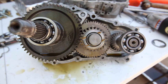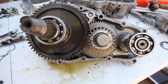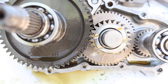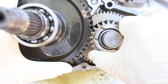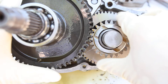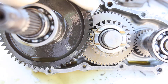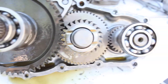I want to focus on what good gear engagement looks like. Let me expose this a bit more. Draw your attention to how these gears engage here — there is almost no movement at all. The teeth engage and bite deeply with no slop. This is the stock gear that was in the transfer case. I was concerned it might have issues, but it looks perfect.